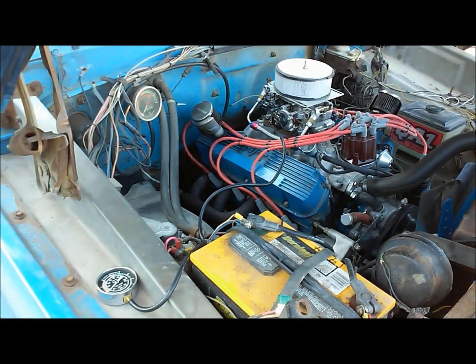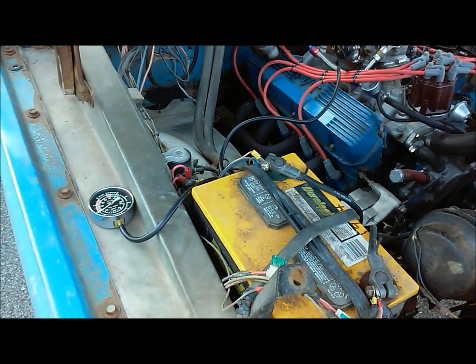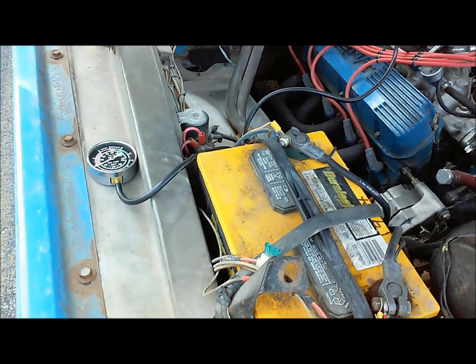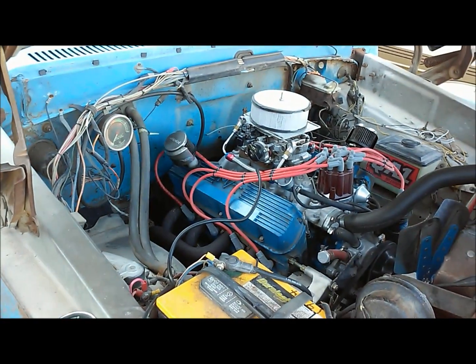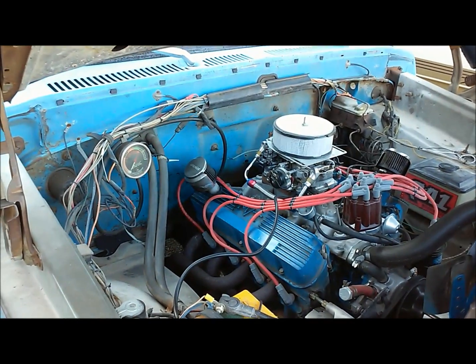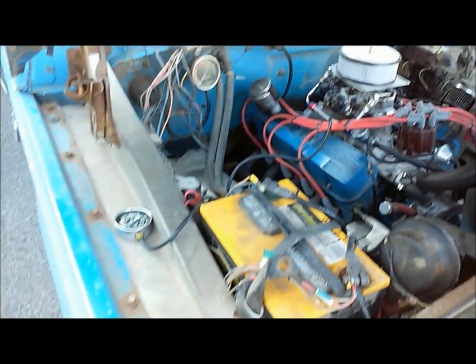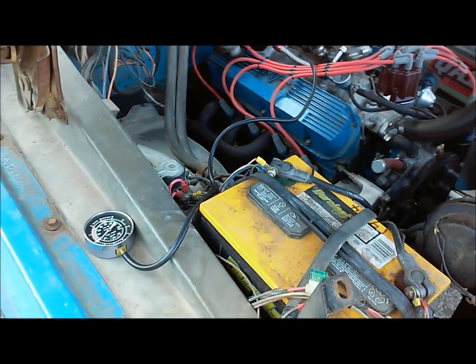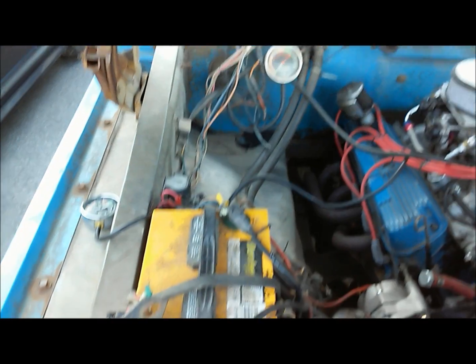There are a couple of different ways you can do this — one being using your tachometer and the other being using a vacuum gauge. Today we're going to use a vacuum gauge because you really get your tune much more exact with this. One step further: if you have an AFR gauge in your car it makes it even simpler as it gives you an exact air-fuel ratio readout, but this truck doesn't have that, so we'll go the vacuum gauge route.